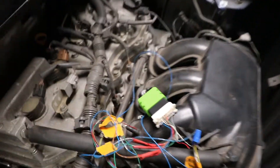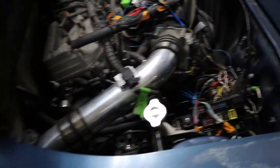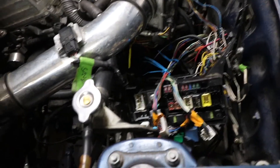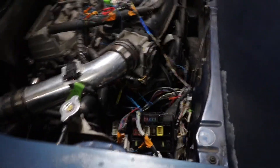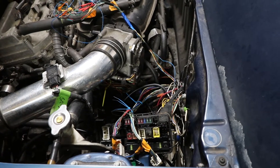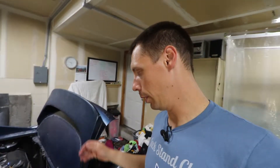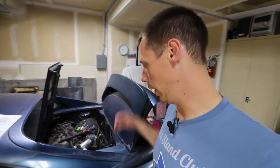I make sure nothing's going to ground out, hook everything back up, and since the car runs and I've got my OBD2 port just chilling on the manifold, I can fire up the car and check the codes — make sure I didn't snip the wrong thing. Because I totally snipped my coolant temp sensor line when I first started this project, and I actually snipped the alternator exciter wire too so I wasn't charging. All sorts of shenanigans — the first night my car didn't want to run. But having the OBD2 working helped me troubleshoot it pretty quickly. So yeah, that's where I'm at — I'm going to go through the remaining two connectors, label everything coming out the bottom, and once only the essential stuff is left, start snipping and take that fuse box out.